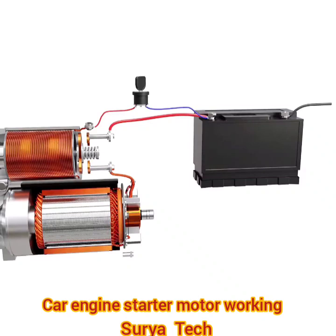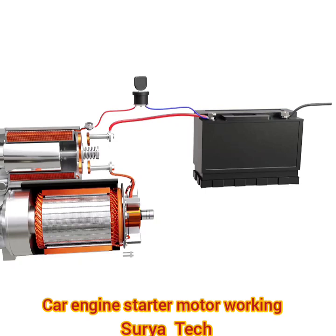A simplified circuit of power supply is shown here. The power from the battery is supplied to a solenoid. An ignition switch is installed between the battery and the solenoid to turn the power on and off. The solenoid is an electromagnet which requires small current to get energized. As the ignition switch is turned on, the solenoid gets energized.